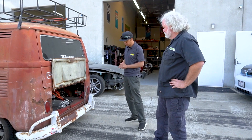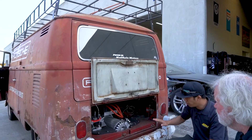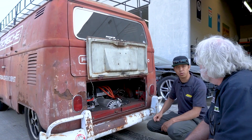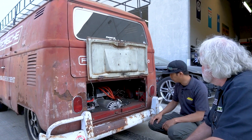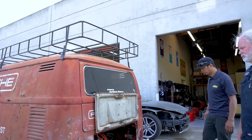The charging is controlled by the VCU. There's a little connector here wired to one of the onboard chargers. The goal is to have a switch inside the charging cover — a switch for your 220 or your 110 charging. If you have big charging and want to use two chargers, flip that switch up, fairly fast charge. If you're dealing with just a regular 110 outlet, flip it down, one charger — keeps the supply circuit happy.